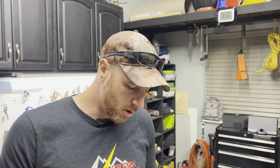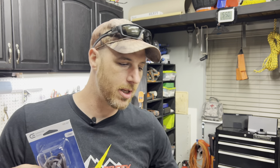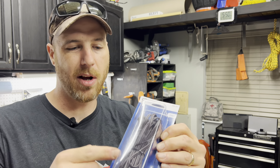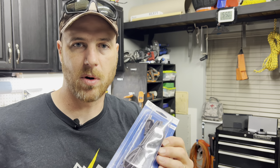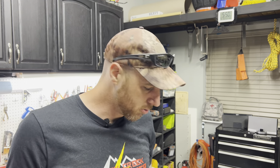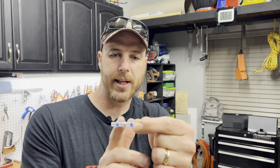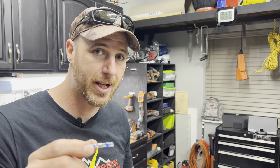You can go to your local hardware store and buy like an eight-foot lamp cord. Obviously this cord is way shorter, probably only three feet because it's designed for countertops. So you can actually shorten it, but the plug is already done for you and all you got to do is shorten the length of the cord to whatever desired length you want. Also, what we're going to do is use environmental splices. These are super cool, super easy to use. You strip both ends of your wire, then just take a lighter or a torch and very lightly melt the solder on the inside, and it joins the two together. Or you can use a butt splice — that's a mechanical connection where you just crimp both sides, and boom, it's connected.